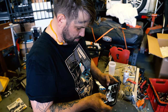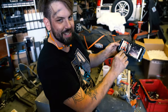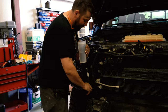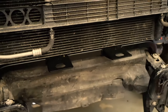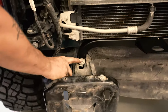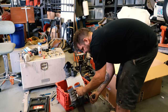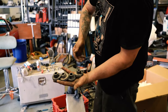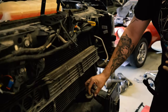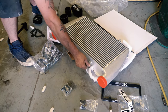As mentioned before, Nick doesn't know how to read and he's looking at the pictures in the instruction manual — it has arrows that tell him what to do. Remember I told you to save those top bolts? That's because the new intercooler bracket — this big monstrous powder-coated piece — bolts in using the factory hardware, into the factory spots. It tucks right up underneath the radiator and the air conditioning condenser. When mounting your new intercooler, you're going to want to make sure to salvage these rubber isolators, because as you can see the hole is very large. The intercooler, like all other radiator intercooler type products, just has a stud, so you pop those right on and get on with your install.